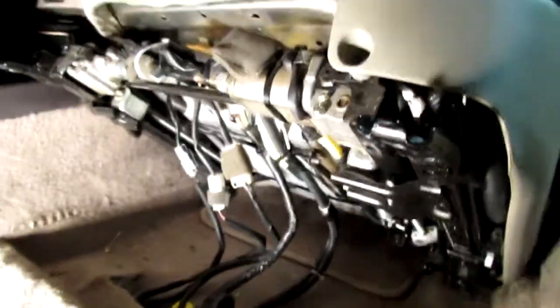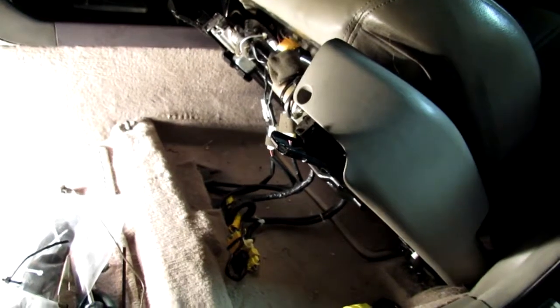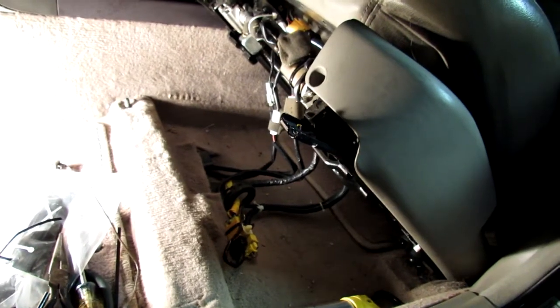So this is the airbag extension cable now. Everything's tight. It's got a good service loop. There's no flexing of the cables against the connectors. It's all tie wrapped, so there's no movement on the connectors, just movement on a service loop of the cable. So, there you go. Bolt the seat back down and hook the battery up, and you may have to take it into Hyundai to get the airbag reset. Hope it works for you.